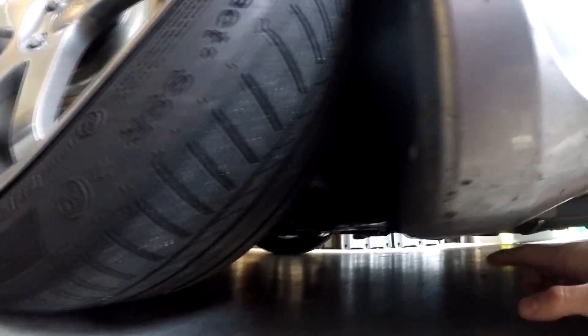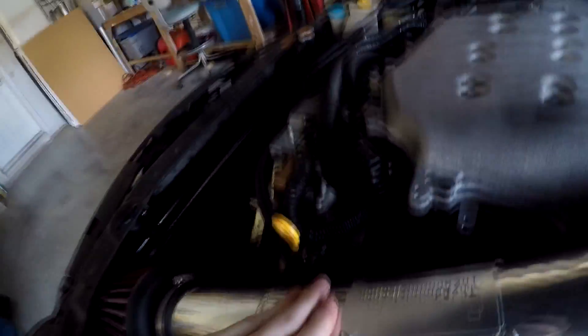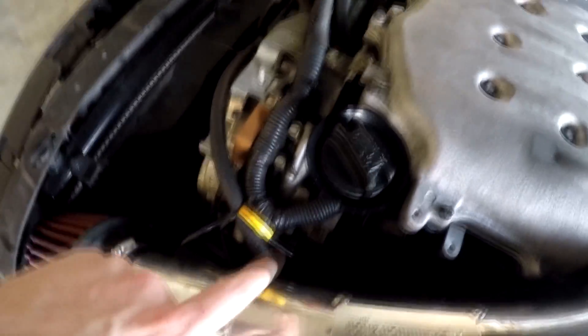As you guys know, if you've been subscribed and watching the videos for a long time, you know that I do have an oil leak. You can see it looks like it's coming from my rear main seal because it's coming from the bell housing between my engine and my transmission. It's really hard to show you guys right now — there's a lot of drips right there in the middle. I've had it up on the lift a bunch of different times and I was able to follow the trail of oil to see where it's coming from. We found out pretty much when we did our headers exactly where the oil is coming from. It's kind of a no-brainer because last time I did my valve cover gasket, I put a video on YouTube, but what I didn't tell you guys was there were two bolts on here that just keep on screwing down — they're really loose, they completely stripped the threads on the engine block itself, this bolt and another one just to the right of it.